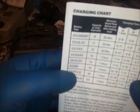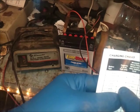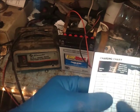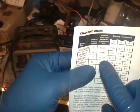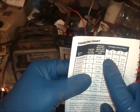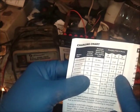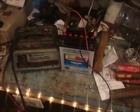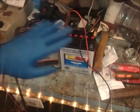Referring back to your guide — I looked at the ES12AA, it tells me 12 amp hours. It states how long on the different size batteries, what's the minimum standing time before and after adding acid — so it's 30 minutes. Then you have the charging hours: you've got 1 amp, 1.5 amp, and 2 amps. Since my charger's lowest setting is 2 amps, it calls for 3 to 6 hours at 2 amps charging. I don't want to go the full 6 and I don't want to go the full 3 — I'll meet in a happy medium around 4 to 4.5 hours of giving this charge. Once I've done that, I'll turn it off. Let it sit 30 minutes, then go ahead and install it on your vehicle and test it out.